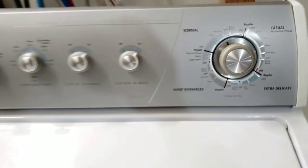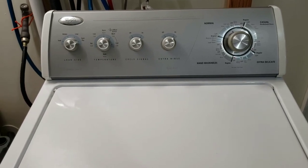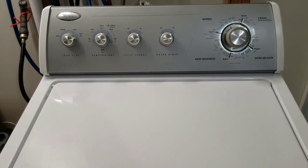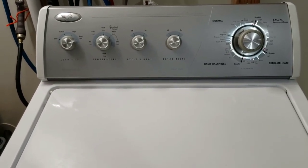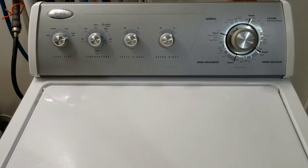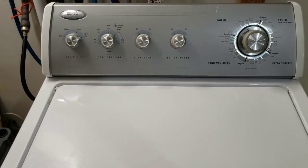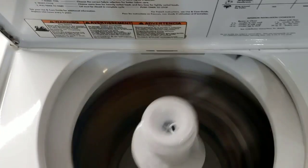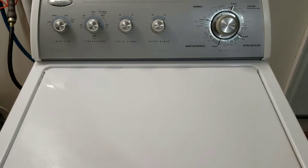We've kicked over into that final spin — it's getting up to full speed. I'm gonna lift the lid up and show you that it is in fact spinning nice and fast. You can see in there it's nice and smooth, even with a pretty heavy load. We'll lift that up — sounds like it's at the fastest point right now. There you can see it spinning nice and fast, and it shuts down when the lid is lifted, which tells you the lid switch is working.